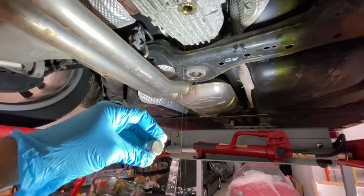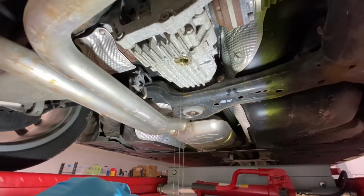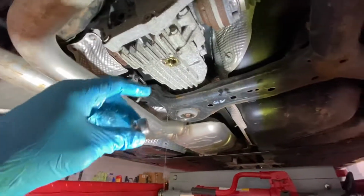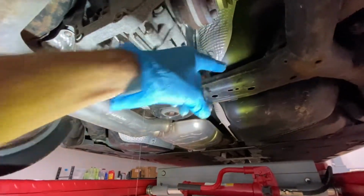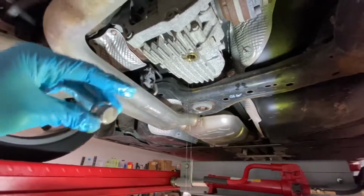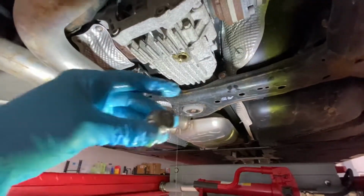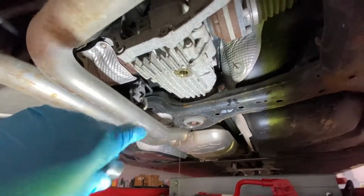Gonna let it drain. And I can obviously show you me filling it, but God, that's boring. You all know that you'd return this into its rightful place. I think it's 30 foot-pounds is the torque. I can always double check. Then you take a pump, you pump the fluid into here until it starts dribbling out. Then you wait a little bit, check to make sure the car is absolutely level. Don't do this on jack stands unless the jack stands are perfectly level. And once you're done, you tighten this plug on the fill side. You're done, you're good for another 30, 40, 50,000 miles.